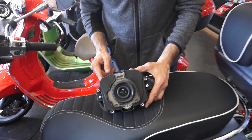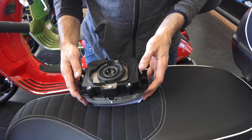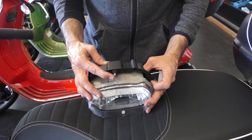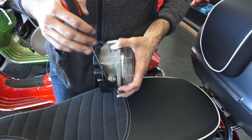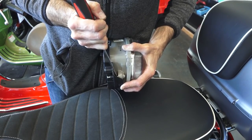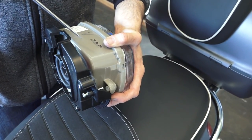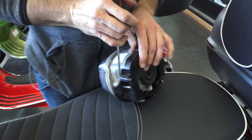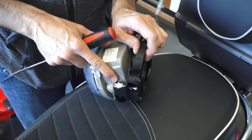This next step requires you to remove the reflector assembly — the gray part with the lens — from the headlight adjustment bracketry, which is this black plastic bracket. It has three screws for adjustment: left and right adjustment, and height adjustment accessible from outside the handlebars. Get a pry tool or small screwdriver between the gray and black parts and very carefully pry until the ball joint pops. You can see there's a metal ball on a threaded shaft — that's part of the adjusting mechanism — it pops out of a nylon socket on the headlight reflector. Do the same for the other side.